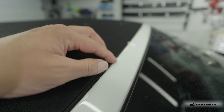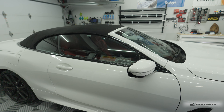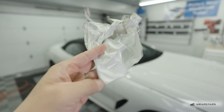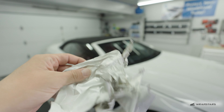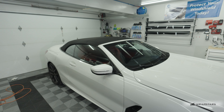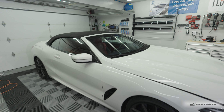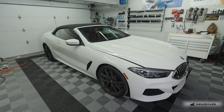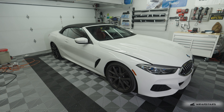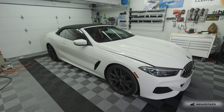This is 3M satin frozen vanilla — I believe it's their 2080 line, which is their more premium line with a cap sheet. The problem with vinyl is it actually discolors, it gets sun damage, UV damage, and unfortunately it creates a mess. After two or three years — this car is three years old and the lease is up — you basically have to remove all that. The cost of removing all this vinyl from the vehicle, we charge them $800. We were on the low end; other shops are charging much, much more for that.